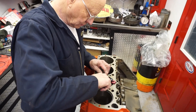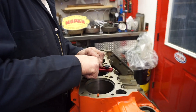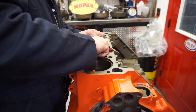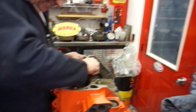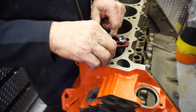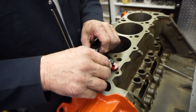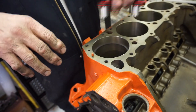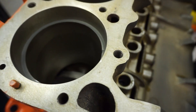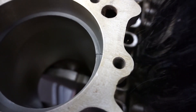Checking the end gap on our rings. I am the chief narrator and that is my job. Did you say chief or cheap? Both. I come at a low cost and high volume of speaking — free. One day you'll appreciate all these videos. So that tool — it's just where they recommend checking the rings, one inch down the bore, and it squares them up. So we're checking our end gap, which is this little gap right here where the two ends of the ring meet, because it's going to expand a little bit under the heat of combustion.